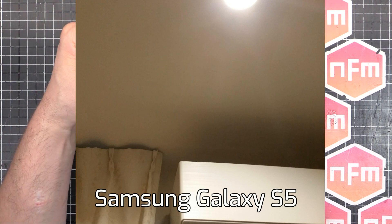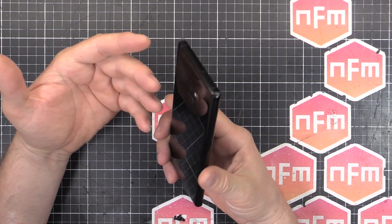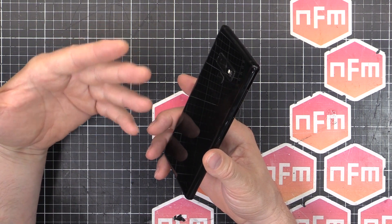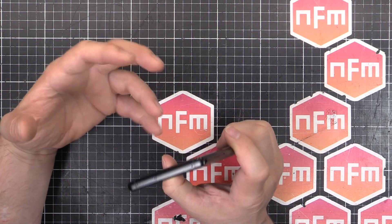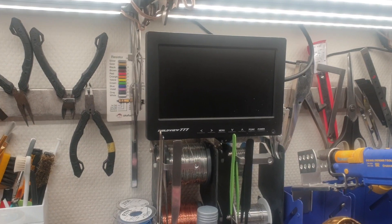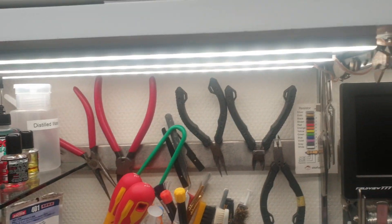That's basically almost unusable. And then also on the zoom lens, the second lens, it doesn't focus. You get a problem where you try to use it and it just buzzes and vibrates and goes nowhere — until sometimes if you shake the phone or tap the phone, it'll somehow catch the mechanism inside and then pull into focus. You can see all that foggy bloom around the lights — this is just my workbench — and that's from the fingerprint inside.